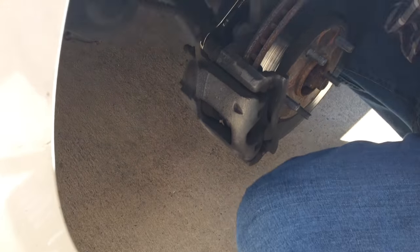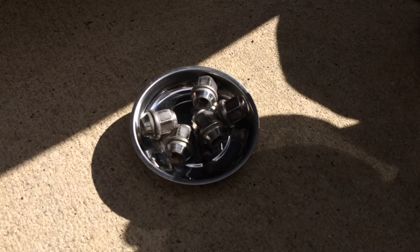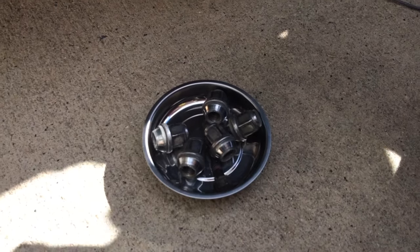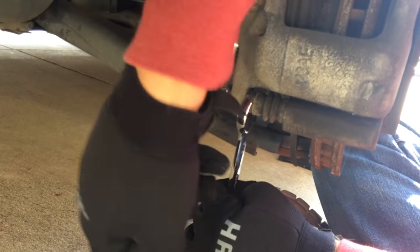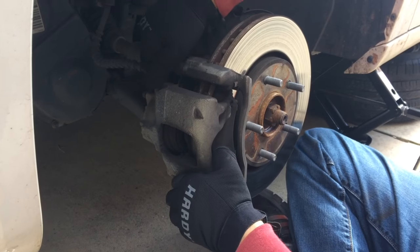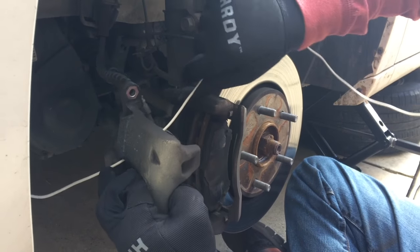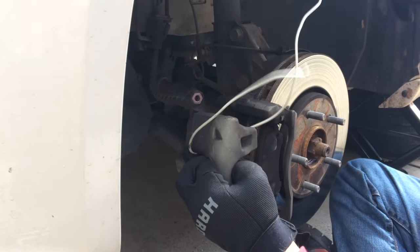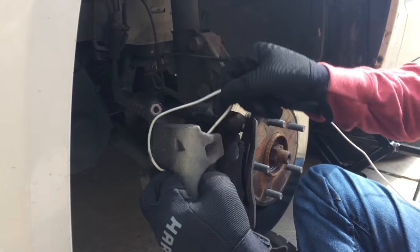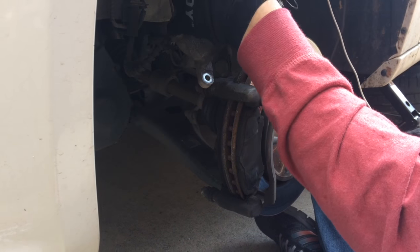The 5/8 is working just fine — comes right out. Set them to the side. I've got a little magnetic tray here — you can get them at Harbor Freight, sometimes with a free coupon. It's helpful so you don't lose your caliper pins or lug nuts. These are really the only two pins you have to take off to get the caliper off. We're going to slide the caliper right off of here. Use a wire coat hanger or old piece of wire to tie it up out of the way, up around the spring.